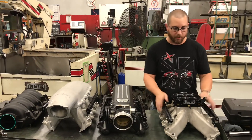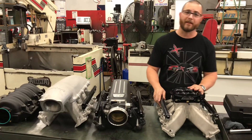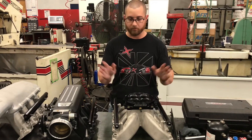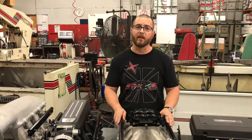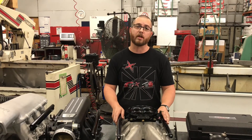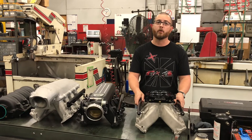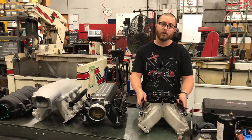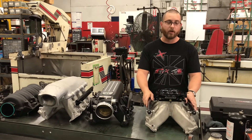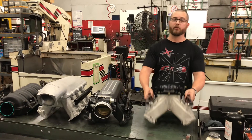Hey guys, it's Toby and we're back. We're going to recap what we've found tonight on the different dyno tests. It's sad to see so many guys that have a 6.0 or a 6.2 and they run the Victor Junior intake because they want to run a carburetor. A single-plane intake, especially on a smaller engine that's not as modified, is going to lose torque and horsepower pretty much everywhere. Even the Super Victor on a 408 with big cylinder heads - those heads flow about 400 CFM at around 700 lift - it was basically the wrong choice.